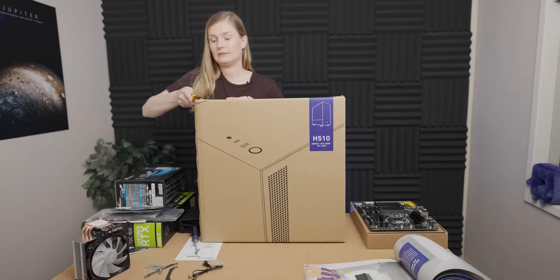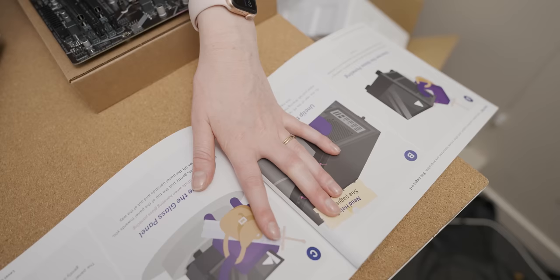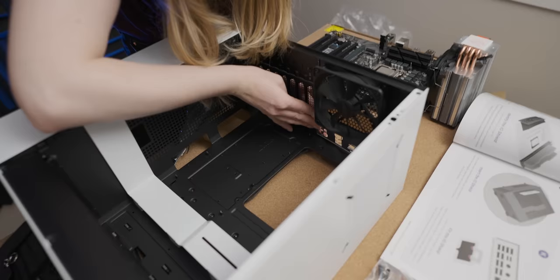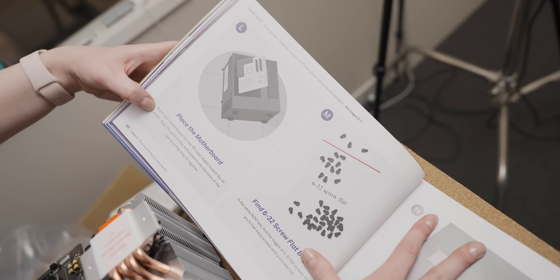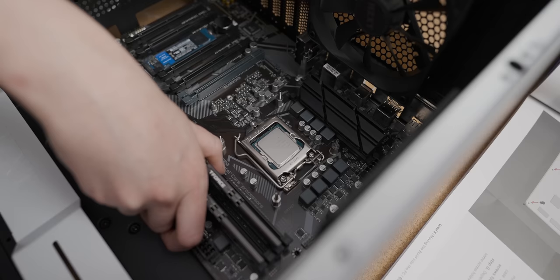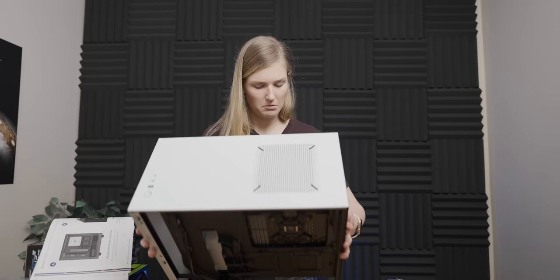Discovery of the H510. Unscrew the glass paneling — they don't come out all the way... never mind, they do. Place it down gently with the open interior facing upwards. Place the motherboard into the case, angle towards the IO shield, align the ports with the holes of the rear panel so that they fit tightly. I'm going to line up my screws — just gotta squish the motherboard a little. David, I haven't dropped a screw. You're not going to get tased then.